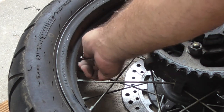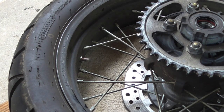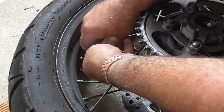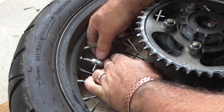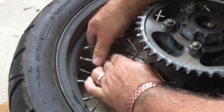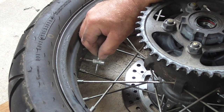I'm going to take out the valve core and loosen the tire. Take off the dust cap - I'll put that in the little box so it's safe. I'll just let a bit of pressure off so it doesn't push the core out and we lose it.